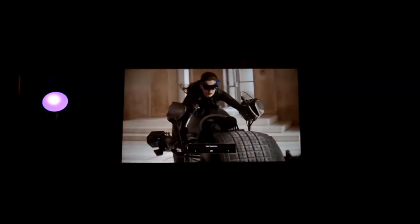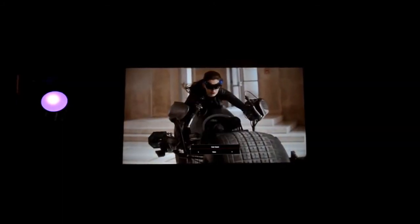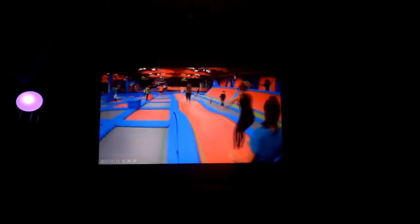Point to note though, in a completely dark theatre room, you might want to actually rein it in a bit, maybe a 6 to a 7, which should give you an overall boost in contrast and saturation, but a lot of people will pretty much stick to the brilliant setting at 10 and forget about it. Let's face it, it puts out the most amount of lumens.